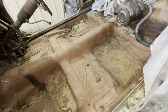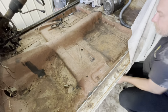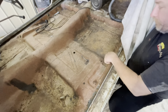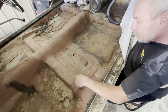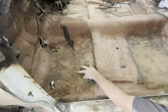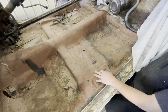There's nothing really else beside that fuel line. I've got to check the brake lines. We've got to unpick it off the intermediate cross member and off the floor supports under here. There are spot welds here. Is it a brake line? No, it's a support. The outrigger that comes off your sill back to here has four spot welds, and there's another one that comes across here to support this seat mount, with spot welds here and here. Do you want me to drill those? We'll have to drill those. There's also the intermediate cross member across here, which has been welded to here, so we'll probably hack the rest of the floor out around it and then grind that off. But there will be spot welds that we need to attack through there. I can start on those?